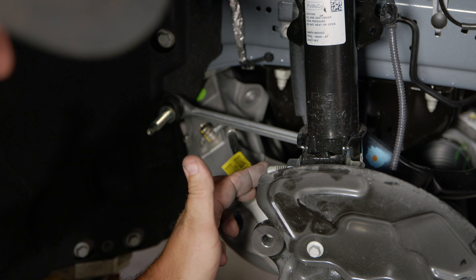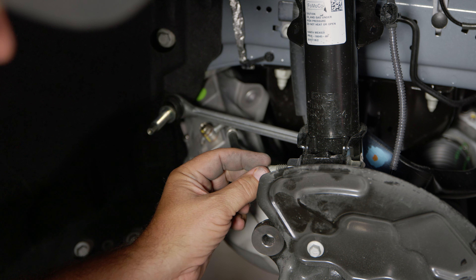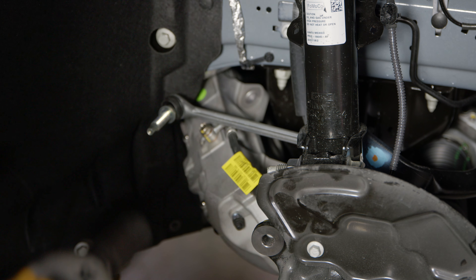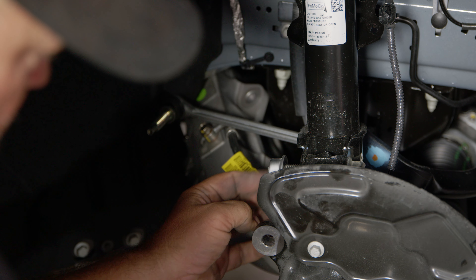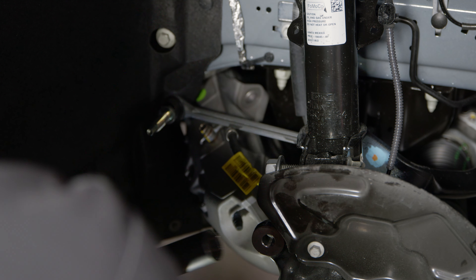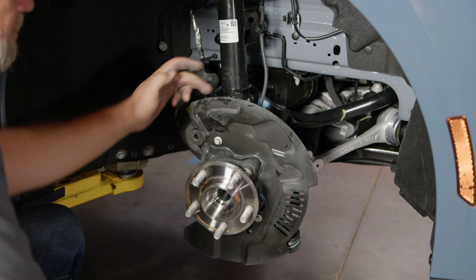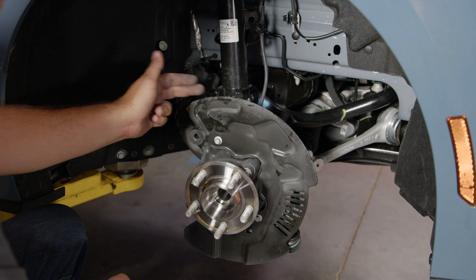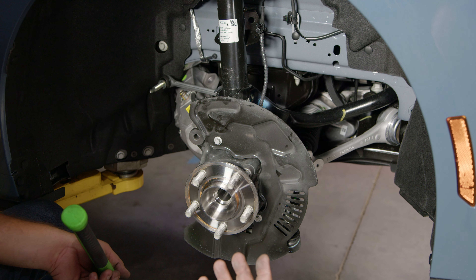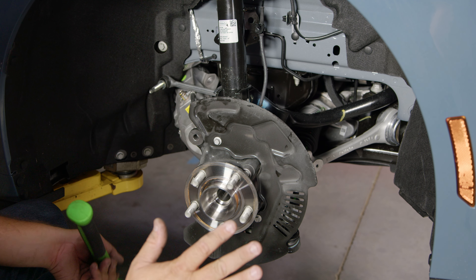Loosen the nut and thread it out past the end of the bolt, but don't remove it, as we're going to have to hammer on this side to get these bolts to come out. If you just start hammering on the bolt itself, you'll mushroom it and it won't go back together. So make sure the nut is past the end and hammer the nut, not the bolt — same thing on the bottom. Now if you need to take out some frustration, basically you're going to hammer these until the nut goes flush with the side of the strut. These are splined, and some cars they're very tight, some not so bad — I've had others I've had to wail on with a sledgehammer.